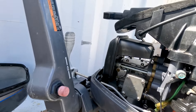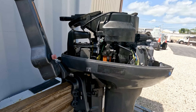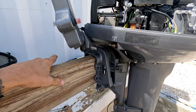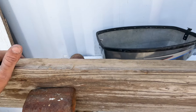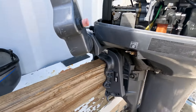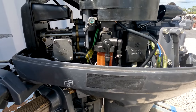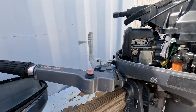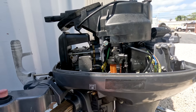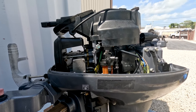So we are back in our shop working on another little kicker motor. This one's a Yamaha two-stroke 15 horsepower. We've pulled out the old Transom 2000 here — fully adaptable, adjustable, universal fit, lockup transom with a two-by-six and some clamps. The complaint was that it just will not start up. We are going to attempt to start it up here in a minute. Because it is a two-stroke, you've got to mix your oil if it's not done on board, and this one is not done on board, so it's got to get done in the fuel tank.